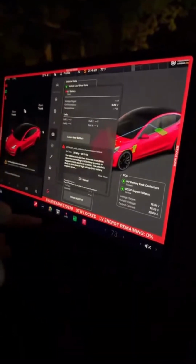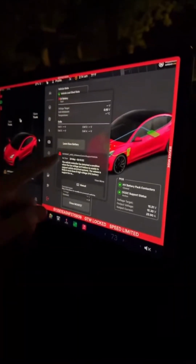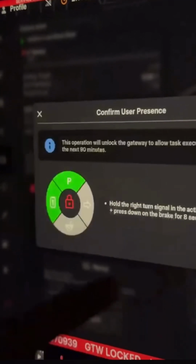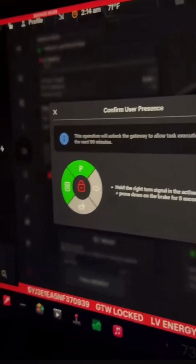There is a battery learn mode. It takes 90 minutes. If it's not starting after you do it, you can go in and relearn this battery. To get into service mode, your input is SERVICE. That'll get you in there, and you just go through the settings and do your battery reset or relearn. That should get you all situated.